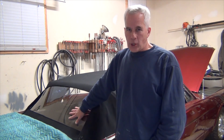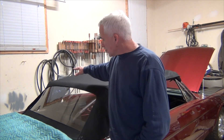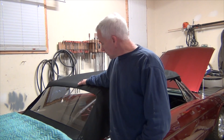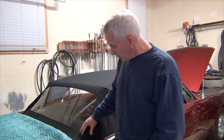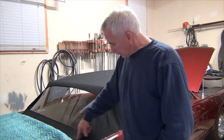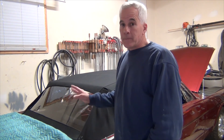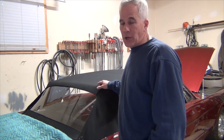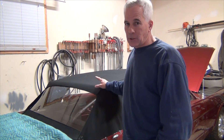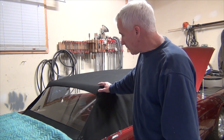The second component is the rear curtain or window. This piece right here is separate from the top — it's not connected to the top at all, except that there are a couple bolts at the bottom that go through the tack strip that holds the top and the tack strip that holds the curtain. But those two tack strips are independent. You can have the curtain installed and not the top, or the top installed and not the curtain, and at some point you'll need to because you'll be adjusting them independently.